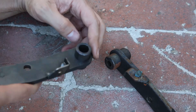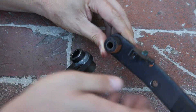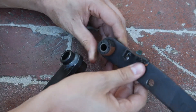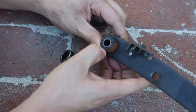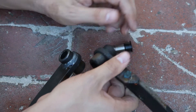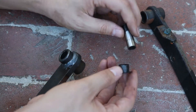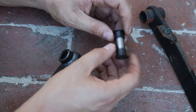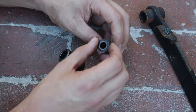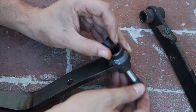When ordering this new brake pedal, one thing I didn't think about is this bushing right here, which is obviously on the factory part but not on the brake pedal I'm removing. I'm going to try to salvage this one since I don't have a new one yet. I can pull it out — it's cracked on both sides, but I can at least use it for now to install it, and later on I can go back and get a new one.